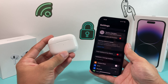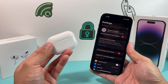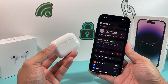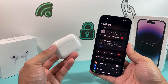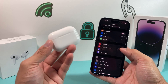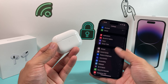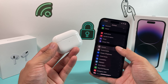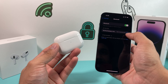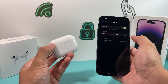Lastly, another thing to note: if you have these AirPods connected to another device, like your older iPhone or another Apple device, disconnect them from there too. Sometimes if they're still connected to that device, the new phone is not going to pick them up as a new connection. You want to go ahead and forget that device's pairing with the AirPods. To do that, go into Settings on that device and go to Bluetooth. You'll see the AirPods listed as connected — something like this.